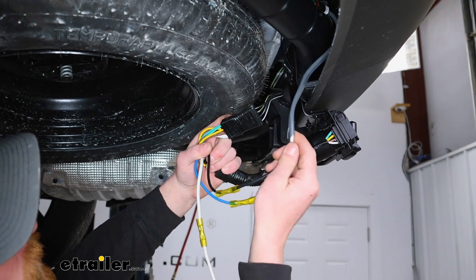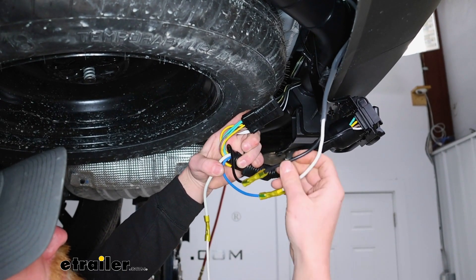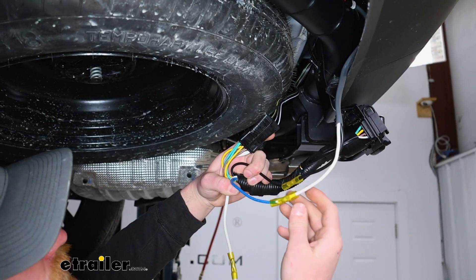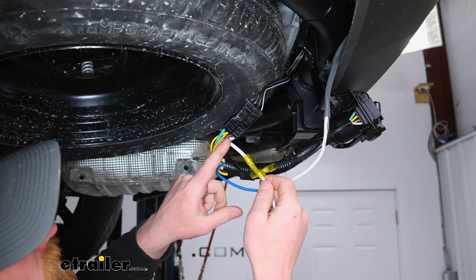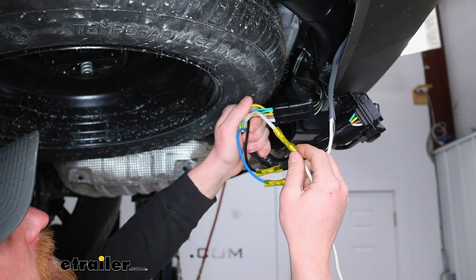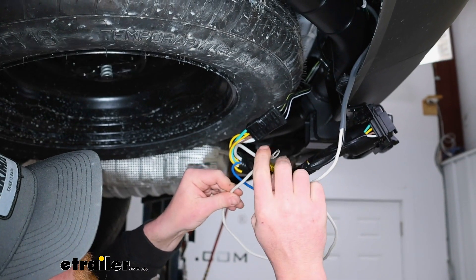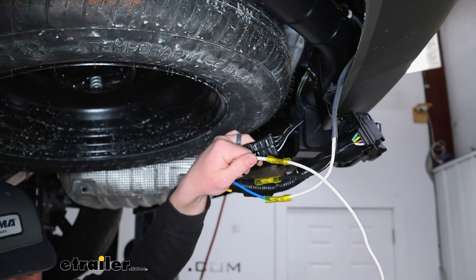The kit comes with a big roll of duplex wiring. If you carefully strip that gray sheathing back, it'll expose two wires — a black one and a white one. The black one will be for our 12-volt power, so that just gets connected to the black wire coming out of our seven-way. The white wire from our duplex wiring will be for our electric brake signal, so that gets butt-connected to the blue wire coming out of our seven-way. The white wire that's the ground coming out of the seven-way will have a pre-attached ring terminal on it, but given the space we have to work with, it wasn't quite long enough to ground it where we prefer. So I took about a foot and a half of white wire, butt-connected it, and crimped on a ring terminal. We'll ground this in a minute, but first since we have heat shrinks, I'll come in with my heat gun and seal up the ends.